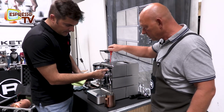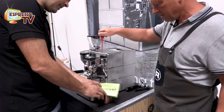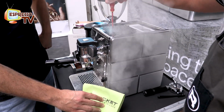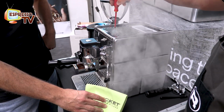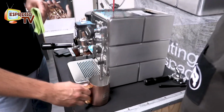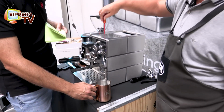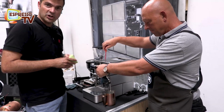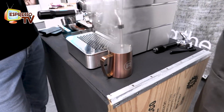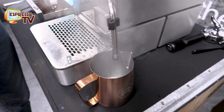Okay. So we open the steam by holding, and by turning anti-clockwise you get the water out from the main boiler in order to renew it. And in fact you have the water from the boiler. So you have the chance to bring some new water inside the boiler and refresh. Here you have now water coming out. You turn then clockwise and it becomes steam. Okay.